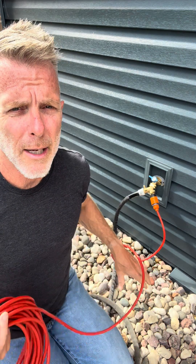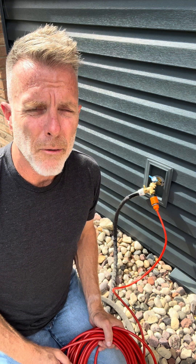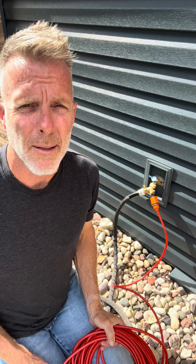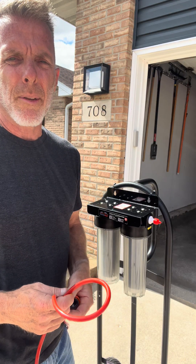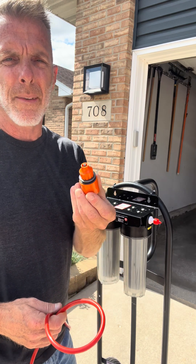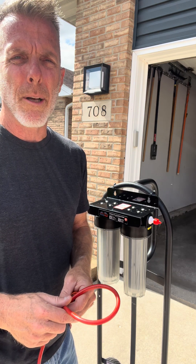To attach the tubing, just take an open end of tubing and remove the orange cap from the fitting. Take the orange cap, slide it over the tubing, and then just push the tubing up onto that gray fitting until it stops. Then replace the orange cap onto the quick connect. For this one here, we're just going to attach it directly to the hose bib and run it out to our Spot Free Car Rinse unit. The next step is to run the other end of that tubing to the supply port on the Spot Free Car Rinse Plus unit. Rather than measuring, I'm simply going to walk the section of orange tubing over to where I have the unit, give it a little bit of slack, make sure I have enough room, cut the end, and attach it there. Now that I've run the tubing out to the unit, I'm going to make a cut in the line, attach another quick connect connector, and click it right onto the supply port.